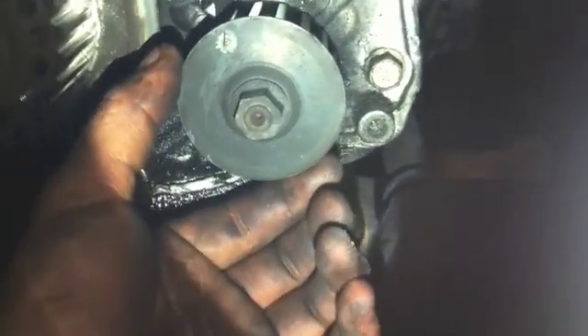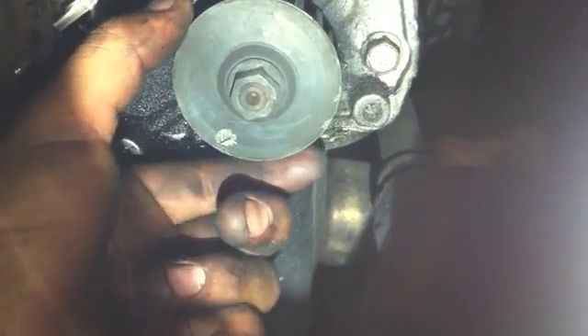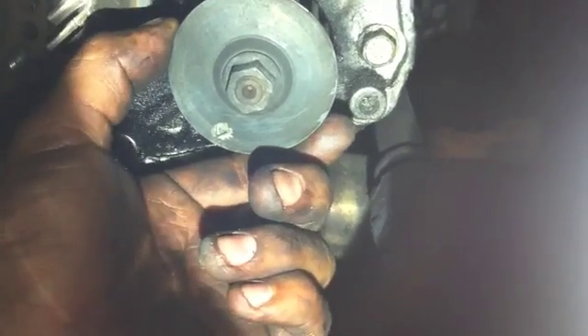Right now it's in the right place. If you turn it, it kind of drives you to the other side, and you can tell by the timing mark on the sprocket that it's not aligned properly — that one's on the other side. So just keep turning until the timing marks are facing each other like this. Yep, that fixed the problem — now runs faster and smooth.